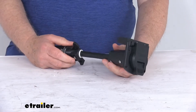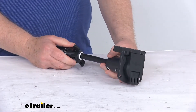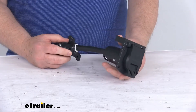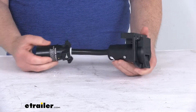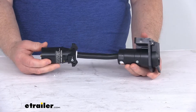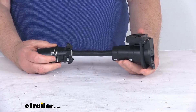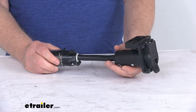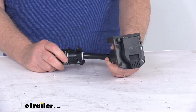This is great for use on vehicles with trailer lamp-out sensors, like the Audi, the Mercedes, and the Volkswagen vehicles that have the factory tow package. What this adapter will do is simulate the increased power draw so the vehicle thinks there are incandescent lights on the trailer, and you won't get the lamp bulb-out reading that usually flashes on the dash of those vehicles.